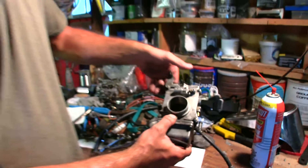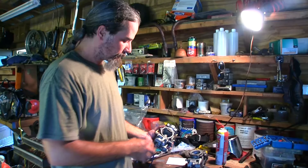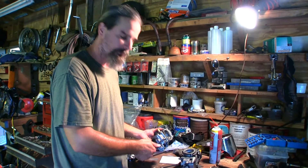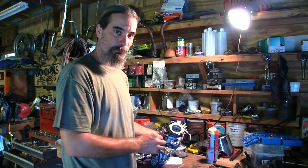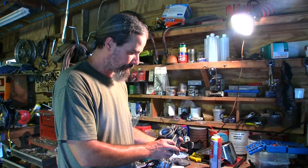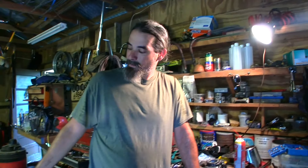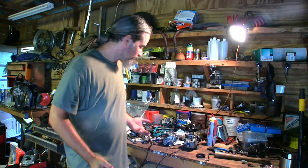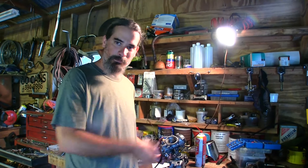On the Mikuni, it has a slide inside too. When you pull the throttle, it automatically raises and lowers that slide — so the slide is not operated by vacuum; it is an immediate response from your wrist, which explains the sudden rush forward. Another difference: the CV carburetor has an idle mixture screw that adjusts how much fuel is mixed with the air idling in there. On the Mikuni it's the other way around — it has a set amount of fuel, and its idle mixture screw adjusts the amount of air mixed in, which is another reason you get really crappy gas mileage. I just want to go wherever I want to go and get there nice, safe, and peaceful, so let's get to installing this CV.